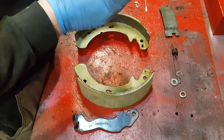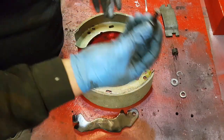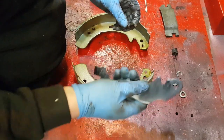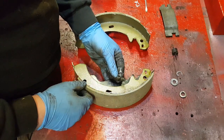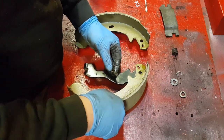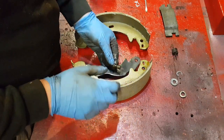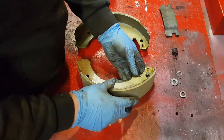Now the pin - you should put standard high-temperature grease on it, not copper grease. Copper grease isn't a lubricant, it's an anti-seize compound, so with this being a pivot for the arm, copper grease goes hard and can cause them to stick. If you think about it - once you pull the handbrake, that arm comes out, the shoes go on the drum, and if the copper grease goes dry it can cause them to stick, so the shoes will be touching the drum slightly. It can cause a lot of heat, or a binding handbrake - that's a better way to say it.